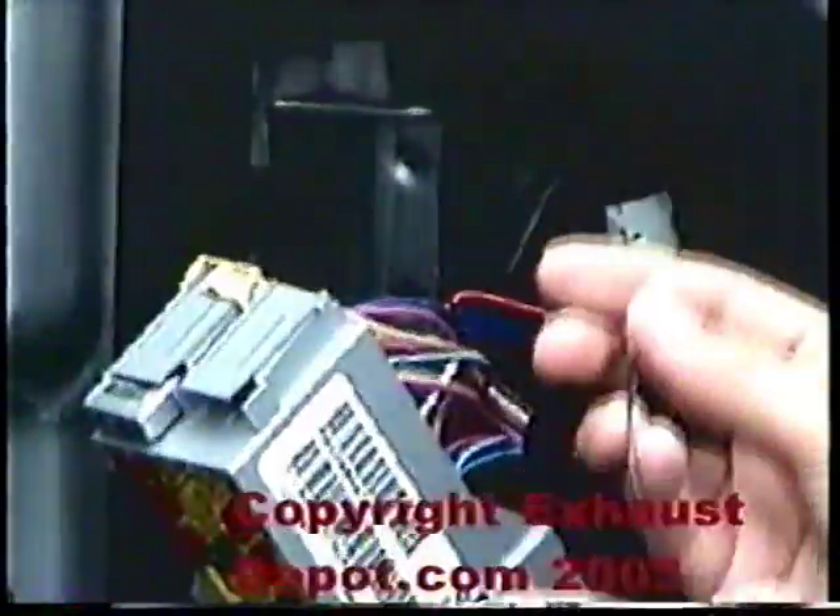This particular unit doesn't come with a crimp on the end like the turbo timers do, but if you have a turbo timer you can actually piggyback this onto that unit. You can solder it on or cut it and wrap it around a bolt and tighten it down. If you are installing any type of fuel computer that works on small AC signals, you want to physically get your own ground for that unit.